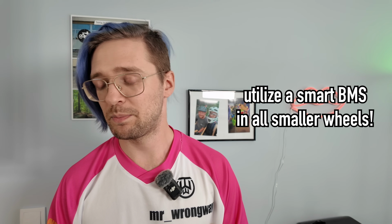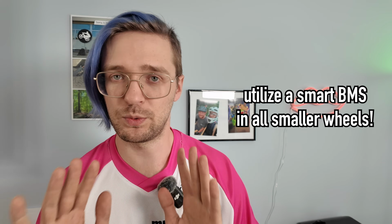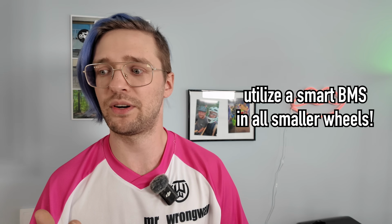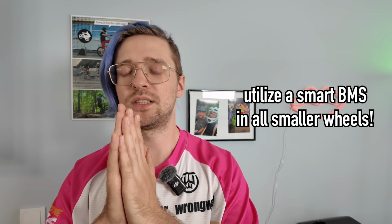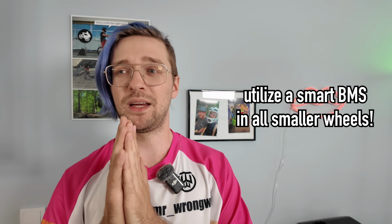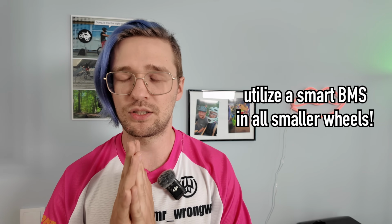What would I actually want from Begode? Well, I would want them to put a smart BMS in all of their smaller wheels, especially the M10.5, the Falcon. I know those packs are small and they still have their battery distribution boards to check if everything's all right, but please just put a smart BMS into them, and therefore you would make it a lot safer. Troubleshooting would be a lot easier, and this is just the way to go.